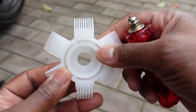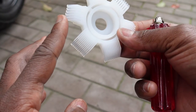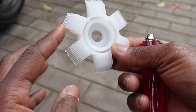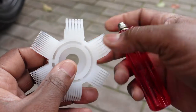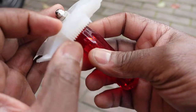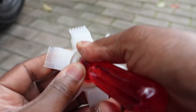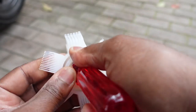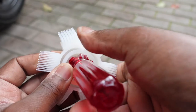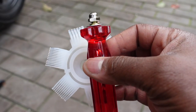You just have to fit it into your particular radiator and see which size is the best fit, because they have different measurements. These ones are kind of wider, even wider, and I think this is the biggest — the widest you can have. Then it goes down to smaller ones. I believe this tool is threaded so you can hold it and drag it down. You fit it into the radiator fins, pick the right size, fit it in, and drag it up and down to properly align the bent radiator fins. That's the first tool I'm going to use to correct the bent fins from that incident.